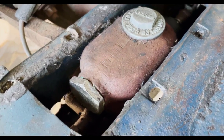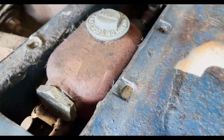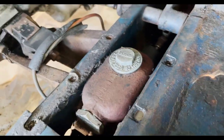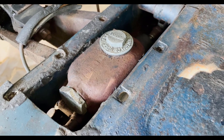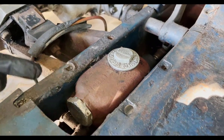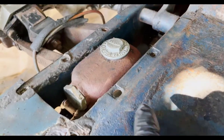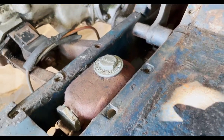The other issue these master cylinders have — which is really a pain — is the way they're hooked into the chassis member. Two bolts run through the chassis member at the front and back of the master cylinder, holding it securely inside. The way they originally came from the factory, the threaded nut side was on the interior side and the bolt head was on the outside. So you'd undo the threaded nut, push it through, and draw the bolt out — as long as it's not corroded. But there's one problem with that, and we'll go underneath the car to take a look.